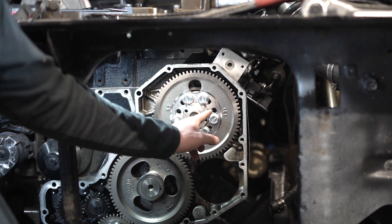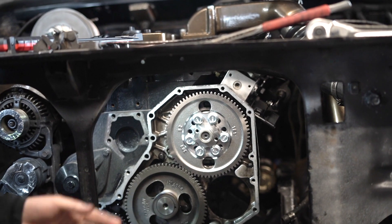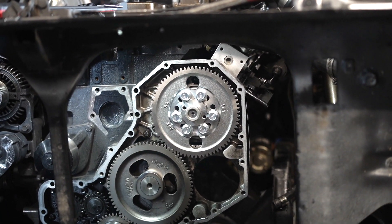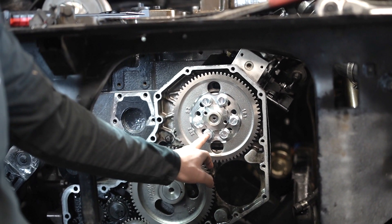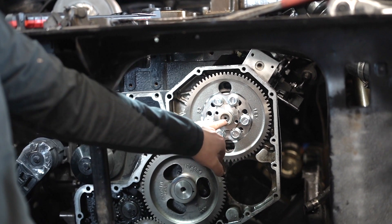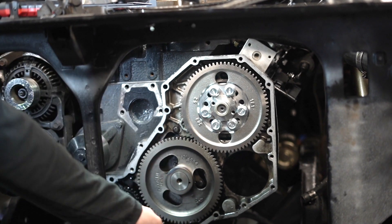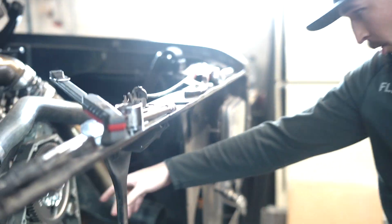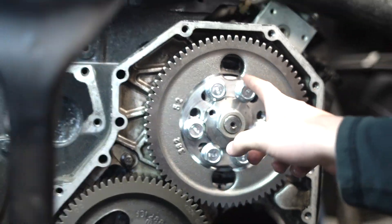When you want to go advance, you only have to pull out two at a time — you have to loosen it all. We'll tighten these and torque them. Torque to 77, and we need this to hold so we can stop the gear from spinning. All right, the new P-pump gear's on — Power Driven. Got this torqued to 150, and then these torqued to 77.